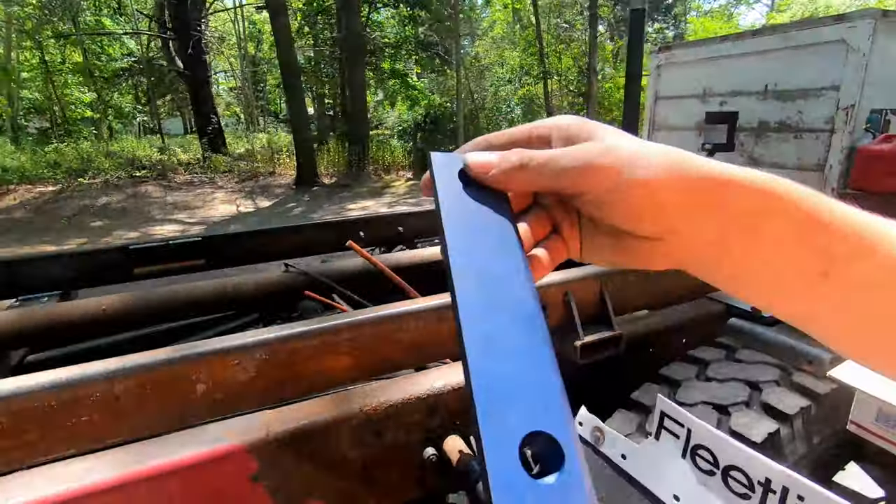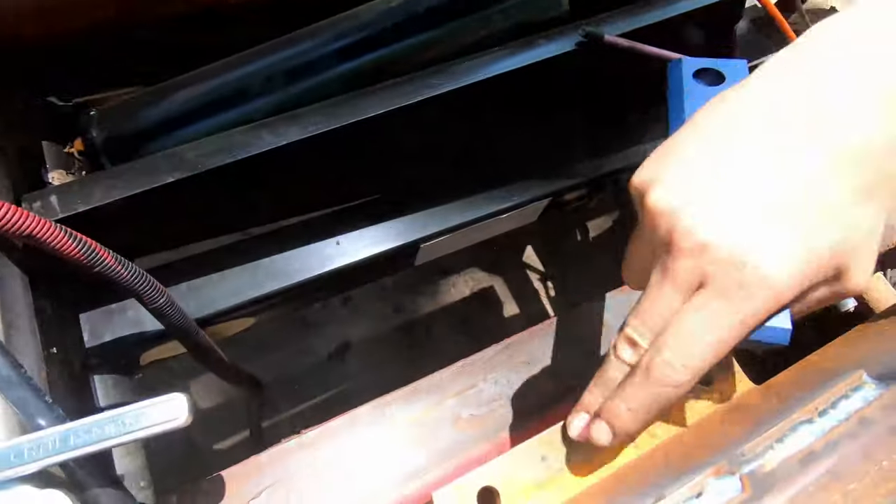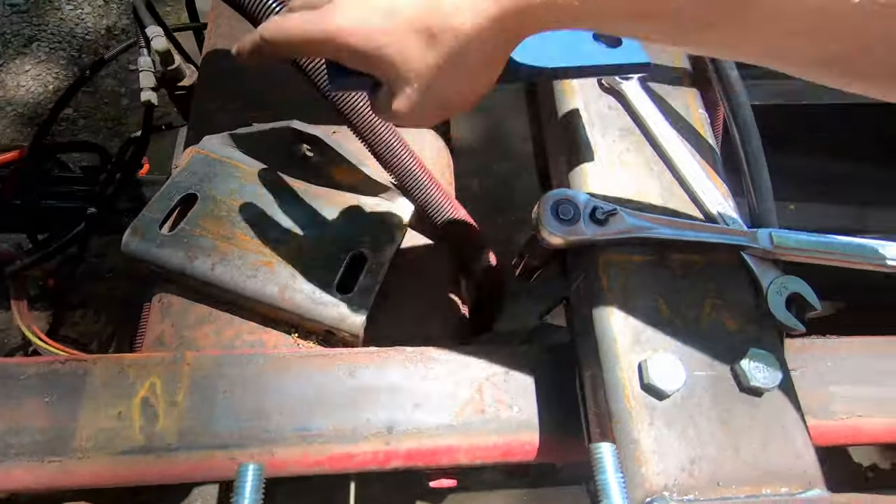The bed's gonna move - I'm so excited, it's gonna be great. Another thing I got to do is get all these neoprene brackets on and get them onto the adjustable brackets. I'm not going to grease them because I'm only going to put the bed on and go in and out just a couple times - I still don't have to weld everything. I'll just bolt them on, I don't think they're going to get destroyed that bad. In and out a couple times, everything works, then strip it all down and weld her up.